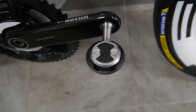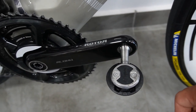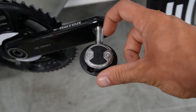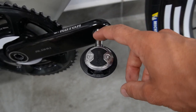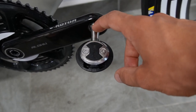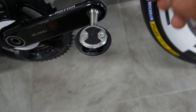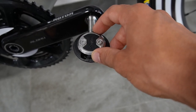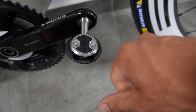Regarding spindles, these aren't widely available from Speedplay yet in different lengths, but it should come. What I have is a pair of aftermarket Dulite titanium spindles, which are shorter than the regular ones — this is because I require a very narrow Q factor, and this helps me achieve that. It's a pretty straightforward change; I have a separate video about it linked in the description. I also experimented with titanium plates to save weight, but the aftermarket ones don't have the crisp engagement and positive feel of the standard ones, so I swapped back.